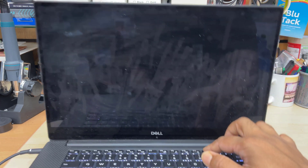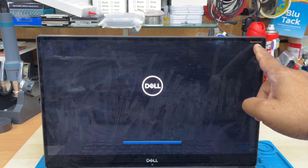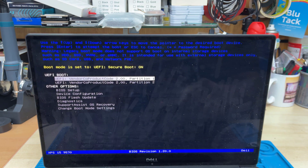Once you click Exit it's going to restart. While it restarts, keep rapidly pressing F12 to get into the temporary boot option — that way you can manually choose your USB thumb drive, your bootable drive. Keep pressing it. Now it shows it's loading up, and at the top the two UEFI entries are my USB stick. I'm going to hit Enter once it's highlighted.